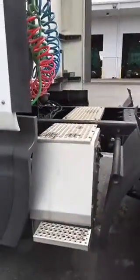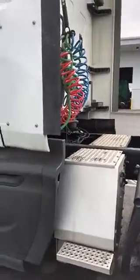And the last thing I'll say, this is, by the way, an International ProStar 2015, and those lug nuts are already coming off. But a lot of guys are confused about what this box here is. This box is on the back of the cab, on the back driver's side of the cab. A lot of people always say, oh, man, that's where my APU is. Well, if you don't have a tri-pack on the back of your truck on these Internationals, that's an extra battery box. That's the battery box that's going to control the inverter. It's going to control the back bunk electronics. It is not the APU.